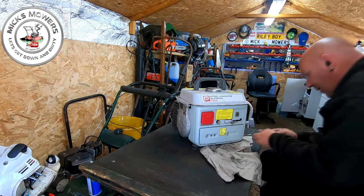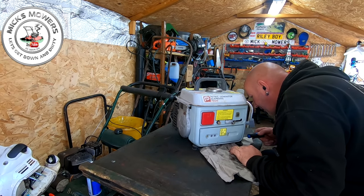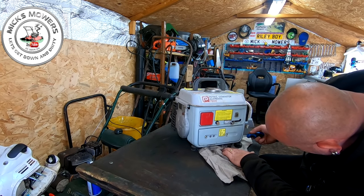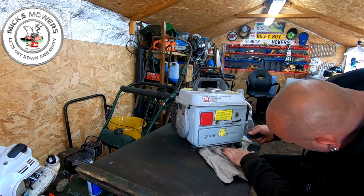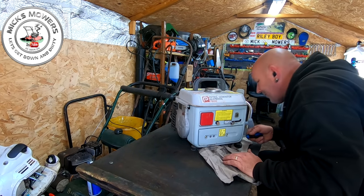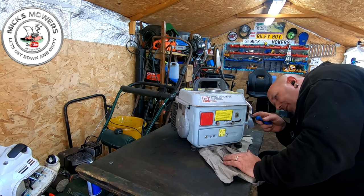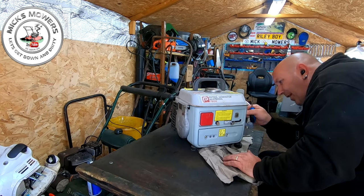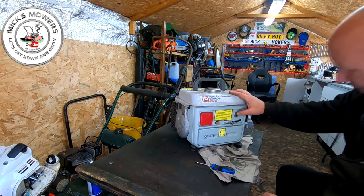There's no naked flames in here anyway, so no biggie. A bit of fuel now poured down. Let's put it onto choke — it's already on choke, in the on position, so someone's already looks like given up with it. Let's give it a couple of pulls and see what it does. Nothing — I'm convinced I'm not getting the right amount of fresh fuel down. That's a bit more watery now — yes, that's fresh fuel coming down. Now I've turned that off, I wasn't getting fresh fuel but I am now. On is up, which is weird because it doesn't look like it's flowing right. Now I've got fresh fuel coming down.